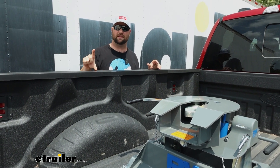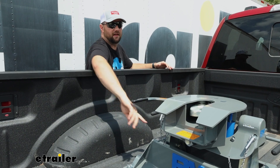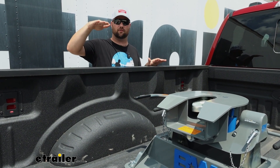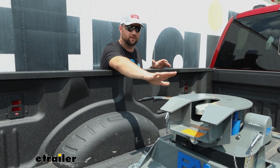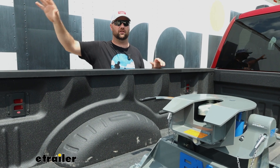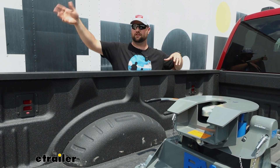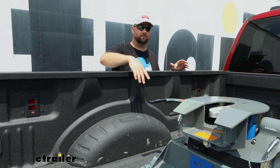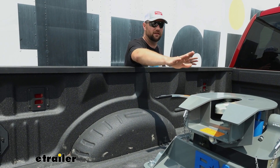To help you tow your trailer nice and level and get that ideal six inches of space between the top of your bed rails and the bottom of your fifth wheel nose, the uprights here will have height adjustability from 16 and three-quarters inches up to 17 and three-quarters inches and 18 and three-quarters inches — so about two inches of height adjustment. There's also height adjustment in the kingpin itself on your pin box on your camper. When you get this new hitch, you'll want to work with both of them. If you need to lower it to give yourself a little more space between the bed and the front of your camper, you have to do that. It's a pain to do the first time, but you only have to do it once for the life of towing your camper with this fifth wheel.